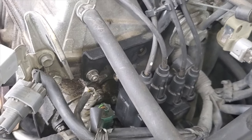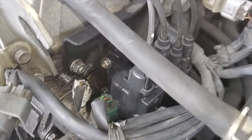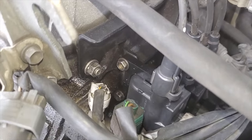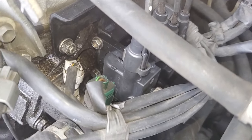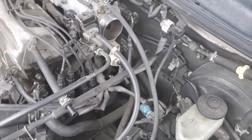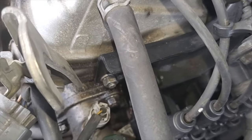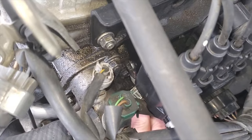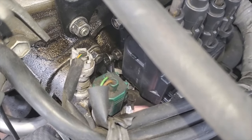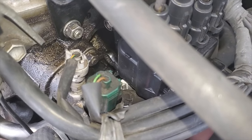Here is where 1A Auto gets things partially wrong. See these two bolts down there? There's one at the bottom and a top bolt — they're both 10 millimeters. The thing of the matter is, like another commenter called out, you have to actually move this entire air intake hose to get down there with your 10 millimeter socket. Got my little box wrench down there. I can crack it loose. You'll probably want to crack this loose a couple full turns, not just little partial turns, but full turns.